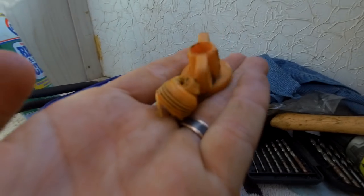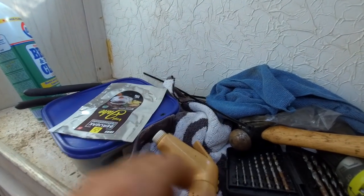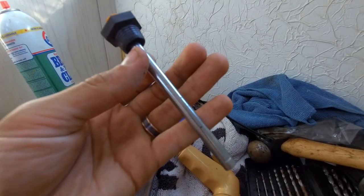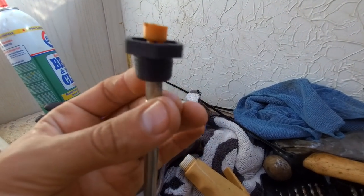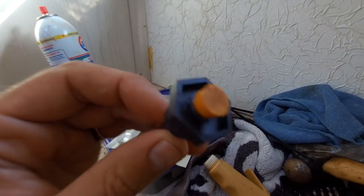White smoke is unburnt diesel, and black smoke is also unburnt diesel — blue smoke would have been a concern because that means burning oil. I also have a dodgy dipstick situation on the transmission: the plastic broke apart inside the housing. I've improvised a fix using the steel part from the other side and a small black plug from the toolbox, with a breather glued on top — not a bad little fix.